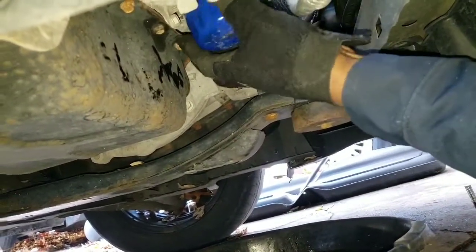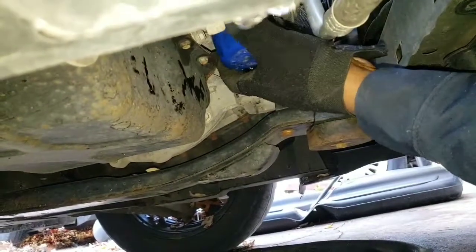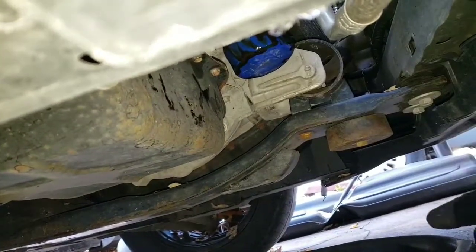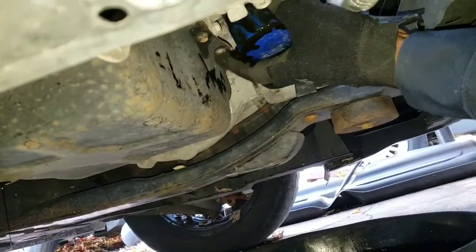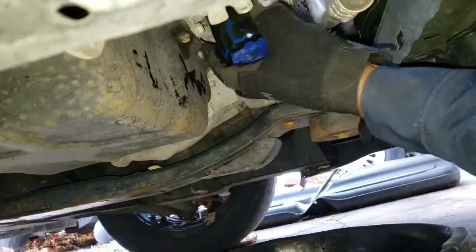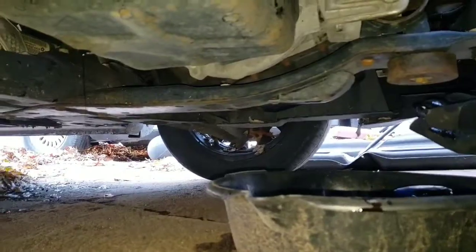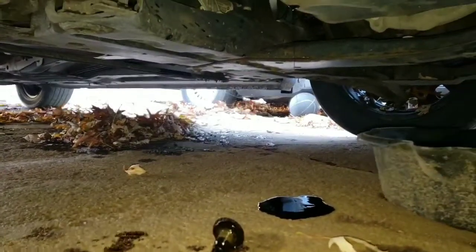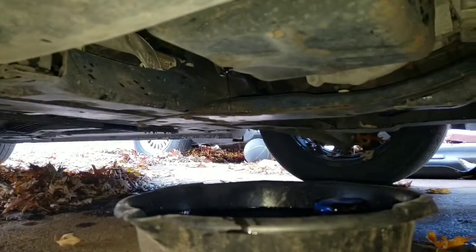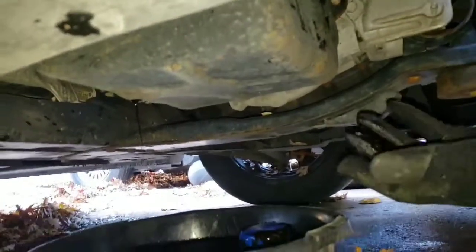You can let the oil filter fall straight in the oil if you want, or you can hold it however you want to do it. The oil is going to come out however you do it. You don't need it anymore, so once you get it off, just drop that sucker right down in the oil. It's done with. It's through. And of course, put the oil pan back up, because a little bit more oil is going to spill out. And let's begin putting the new filter on.